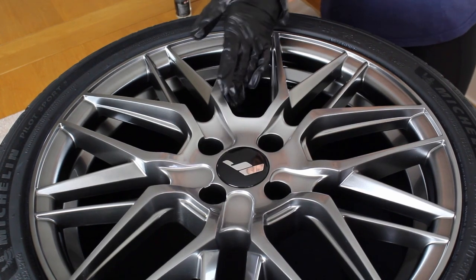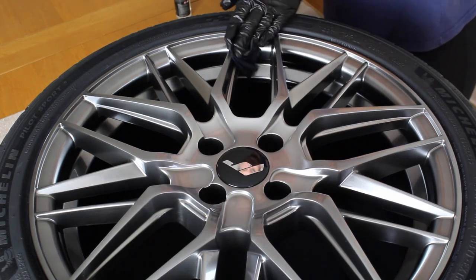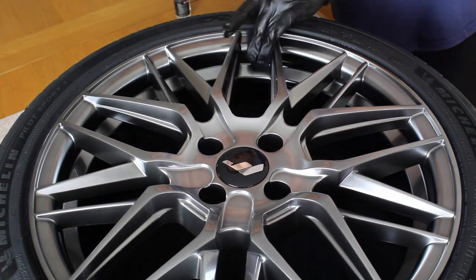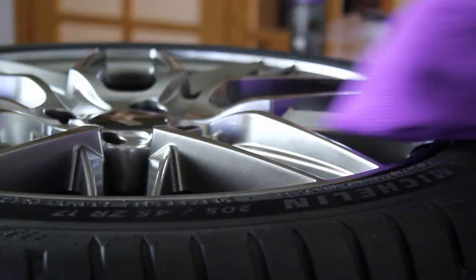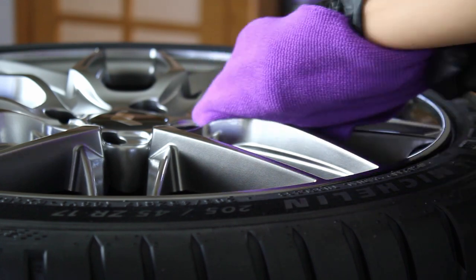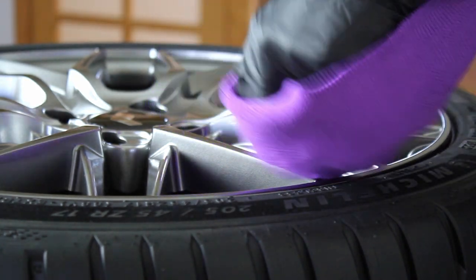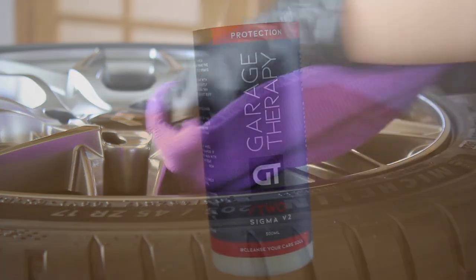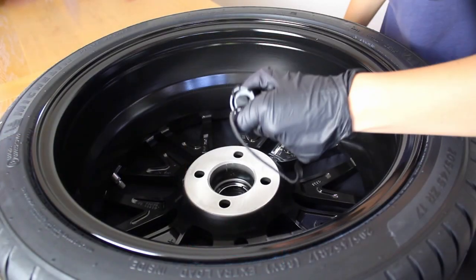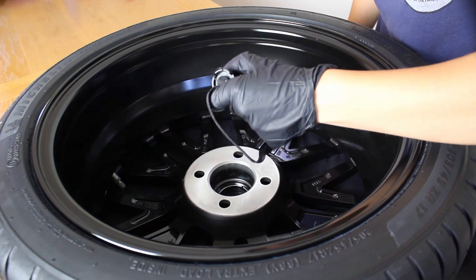With this being a ceramic coating, there is a cure time to keep in mind. The coating will be fully cured after 7 days, and during that period it shouldn't be washed as that will interfere with the curing process where the coating is actually hardening. It is tack-free after 4 hours, but you should keep it dry for 24 hours. If you need to get the wheels back on the car and are concerned about the cure time, you can apply either Garage Therapy Sigma or the quick detailer on the wheels after around 8 to 12 hours after applying that second layer — though you should wait as close to the 12-hour mark as possible, and even longer if you can.